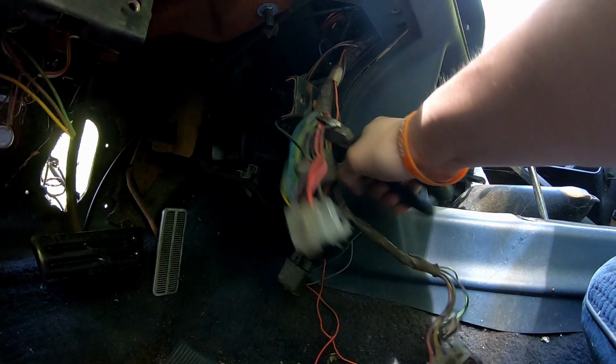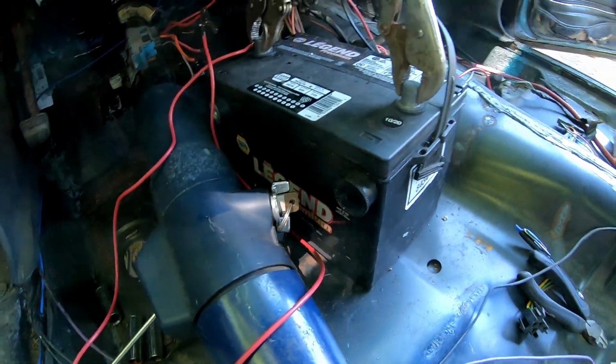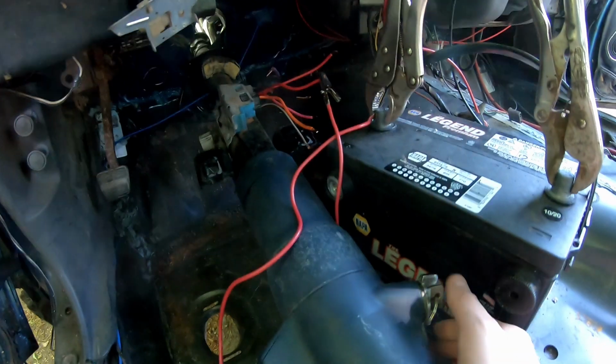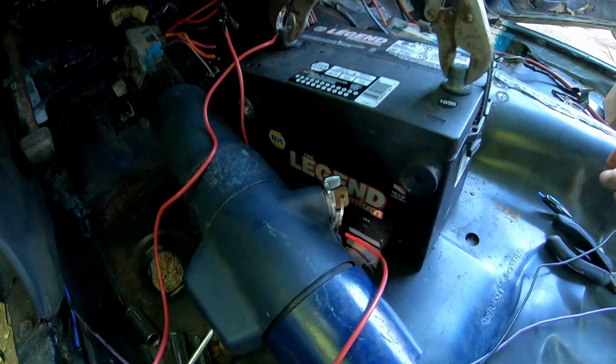There are some purists out there crying right now. Let us go and see what we can do with these. Okay, so this is sketchy, if that's the word you want to use. So I cut the connectors off of the blue car and I plugged them in here. What I did is I'm feeding 12 volt positive and I'm testing different key positions. So trying to find out which wire gives me key on.